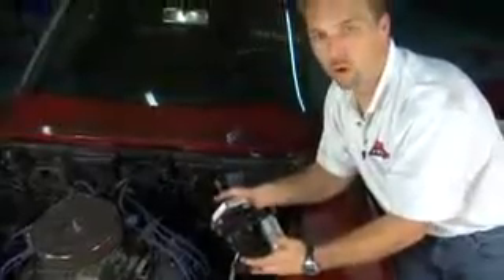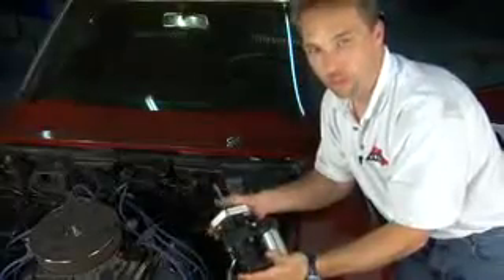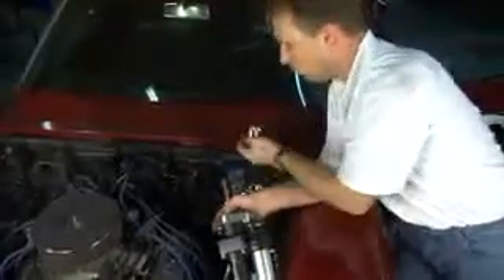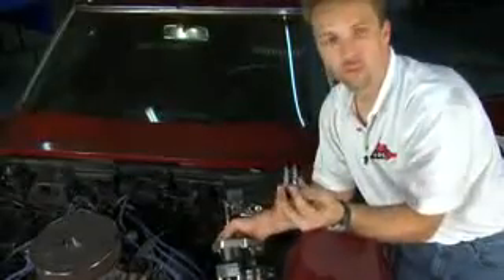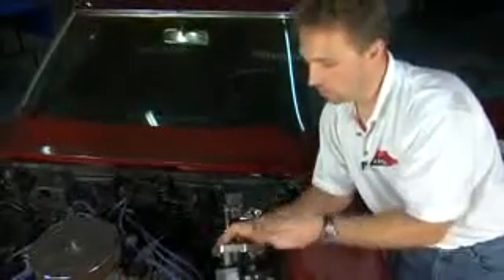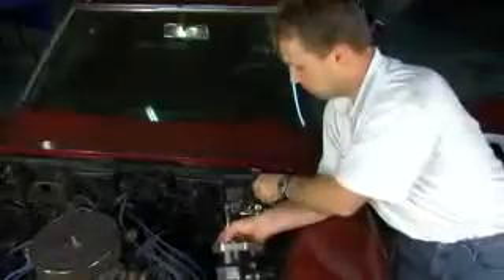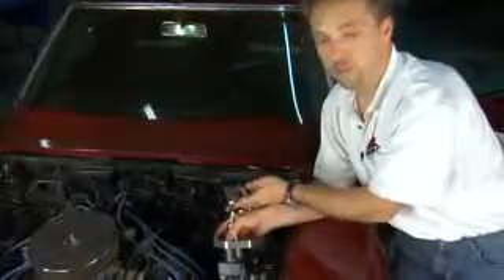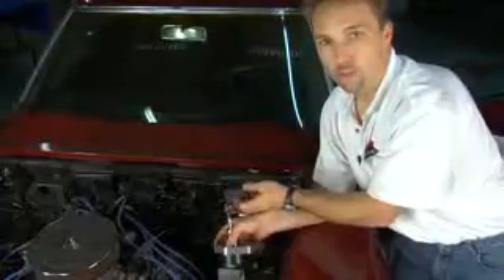It's very important: if your car was originally a power brake car and you're going to a HydroBoost type system, you need to specify that when you order because it will have a different plate to match your firewall. Also, inside the car, once you remove your original master cylinder — whether it's power or standard — it will have a clevis pin that connects to your brake pedal. Your HydroBoost assembly includes a new pin and clevis so everything underneath is fresh. It's also adjustable on the tip of the HydroBoost assembly so you can set your brake pedal feel and play within the appropriate tolerance.